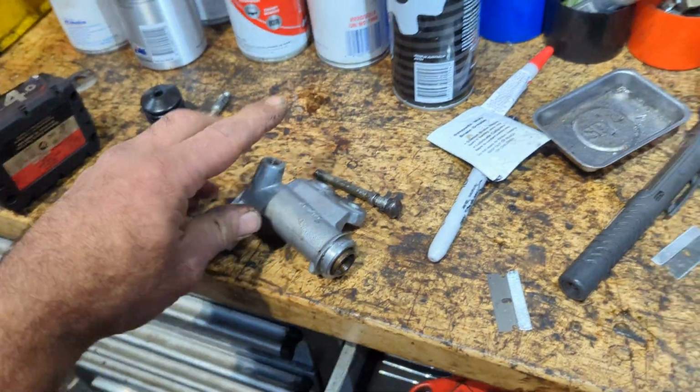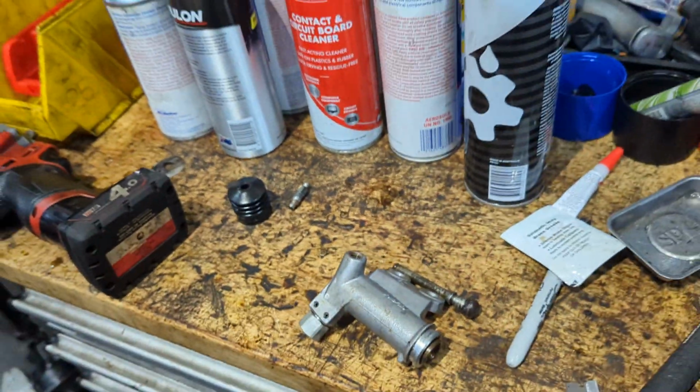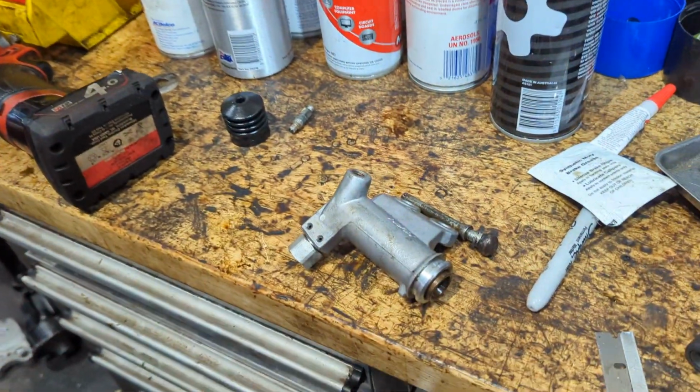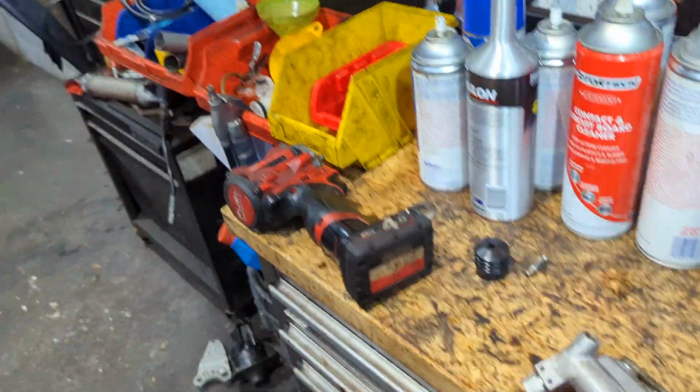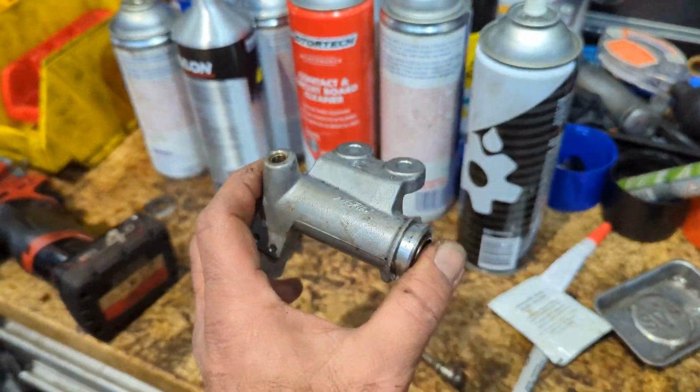You've got to be very patient. You'll feel the vacuum on your finger. Make sure there's brake fluid on your finger. And what you're doing is basically bench bleeding it on the car. You can't bench bleed it and fit it to the car, right? And it's not about tipping it that way for the air to come out, right?